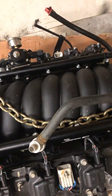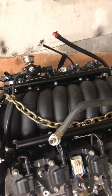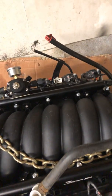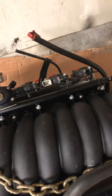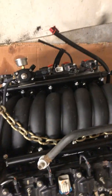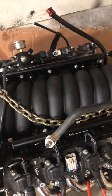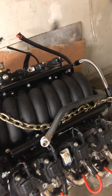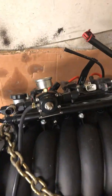Holley wants you to run the fuel in through the rails and out the other end. The factory GM system is a return system too, but it returns before it hits the fuel rail. On the Escalade the fuel pressure regulator is down near the gas tank. For most high-performance cars, the fuel filter and pressure regulator are all-in-one, set at 58 pounds — like the C5 Corvette. I went with a Holley fuel pressure regulator, which is right over here with the gauge.